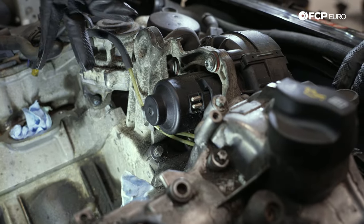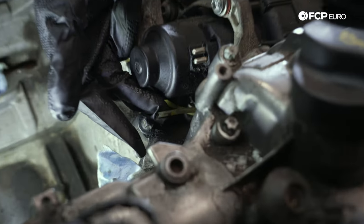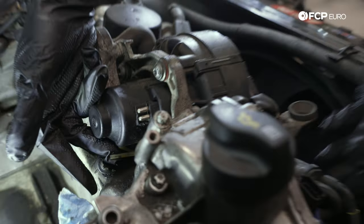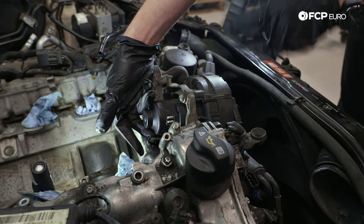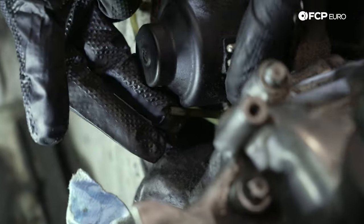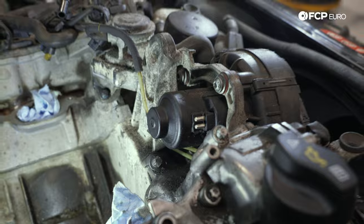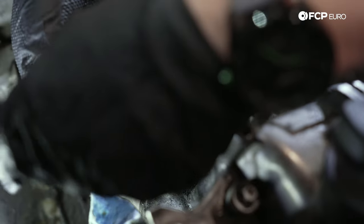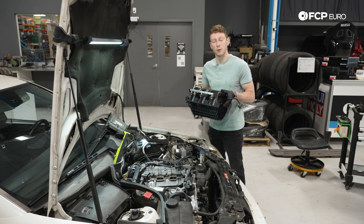So if your vacuum lines are a little bit more brittle — particularly around the secondary air pump — you may remember that the plastic nipple broke off in ours. When I was trying to remove that, it turned out that the actual vacuum hose going up into the manifold from the secondary air pump check valve was just dry rotted and nasty. So what we did is cut a slit down the remaining portion of the rubber hose, took it off the last bit of nylon tubing, and then we can just take some vacuum line, slide it directly onto the end of that nylon hose, and connect it to our new intake manifold. So we have our rags pulled out, everything is ready to go, and we are ready to put our manifold back in.